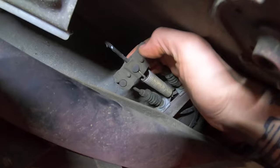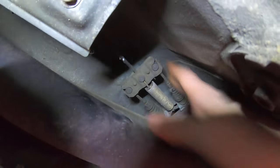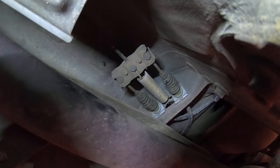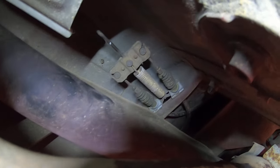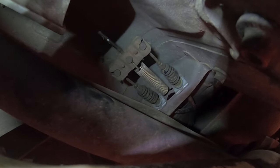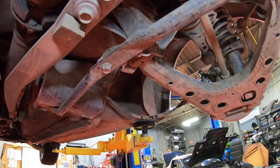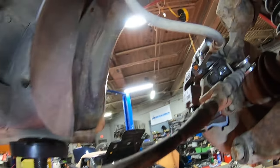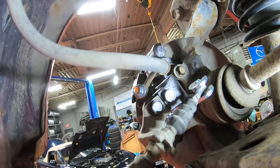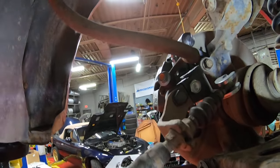It should be adjusted just to the point where it doesn't have any slack, everything's balanced out. If you give it just a little pull, you should see those two levers on the parking brakes move — that's also a good test to see if you have a seized cable. So again, you should not have to adjust the handle. If you're thinking about adjusting your parking brake, the first thing you should be thinking about is coming down here and looking at the caliper adjuster.